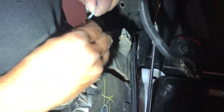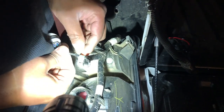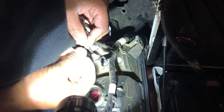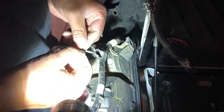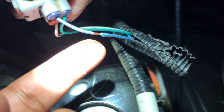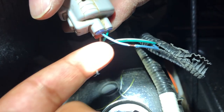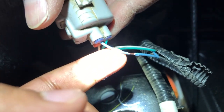What we had to do was open up the factory wiring — you can see there's some weather shielding there that we had to cut. Because we don't have a tap and we're going to splice right in, we're taking off this factory electrical tape. Once you're finished with your tap and everything, you're going to want to tape all this back up properly, but just to have more space to work with, we're undoing everything from the factory and we will tape it all up again. Using the smallest gauge, you're going to feel for a bite and just massage the protection of the wires down. Be very, very careful with this — we've exposed enough wire to successfully tap into our brake light.